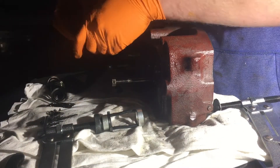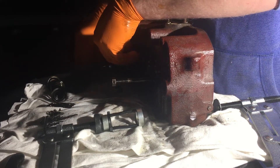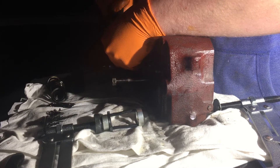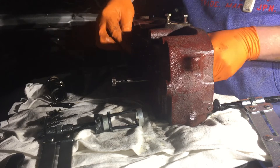Take your springs off. There's a little retaining cap there. The valve stem oil seal here is broken, so I'm just going to pull that away with a pair of pliers and push the valve out the bottom.